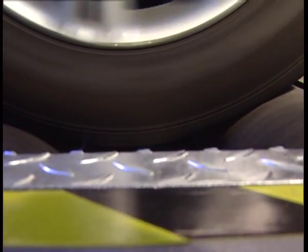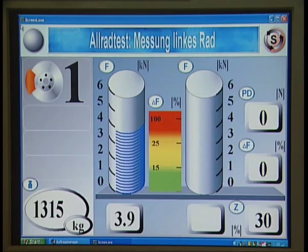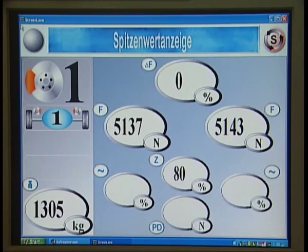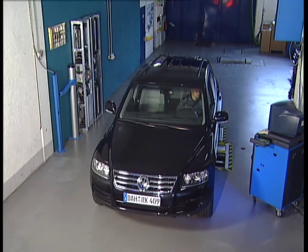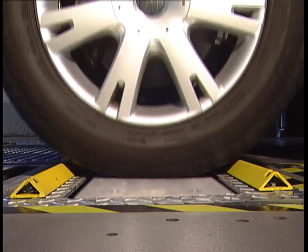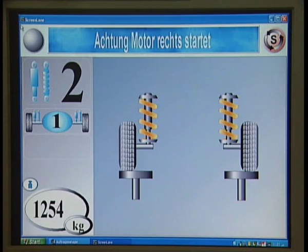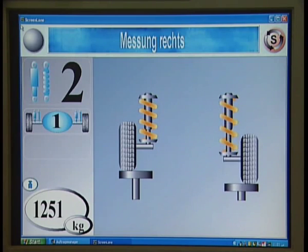The vehicle will be moved onto the roller set until it comes to rest on the test rollers. When the test rollers start moving, the engine must run idle. In the case of vehicles with an automatic gearbox, select Neutral for the gear lever. A special function of the SL680 test lane: a four-wheel drive will automatically be recognized and measured in counter-rotating direction. Following that, the entire procedure will be repeated for the rear axle and the parking brake. It is irrelevant whether the parking brake acts onto the front or rear axle.